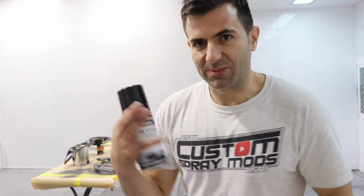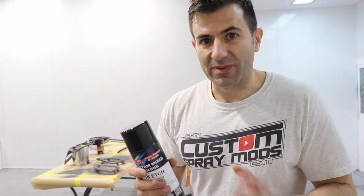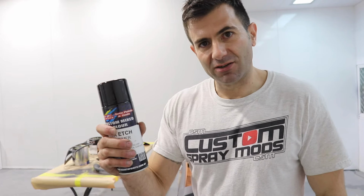Okay, I know what you're thinking. I don't have a spray booth, I don't have a spray gun or a compressor. Well, don't worry, this stuff is available in spray cans. The adhesion promoter was a spray can, and the etch primer is also available in spray can in black. You can get this from a good paint shop in black. Most of the time it's grey. Either way, doesn't matter. It's in an aerosol, and you'll get the job done.